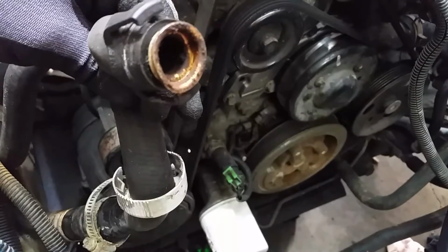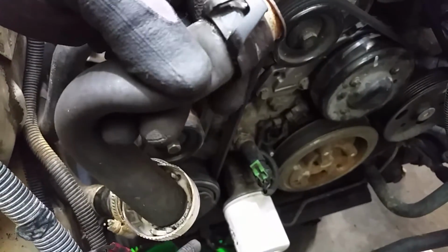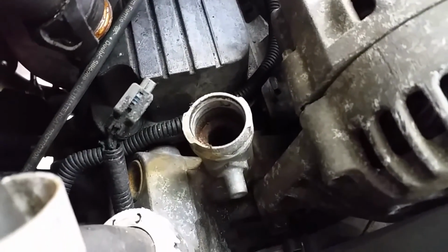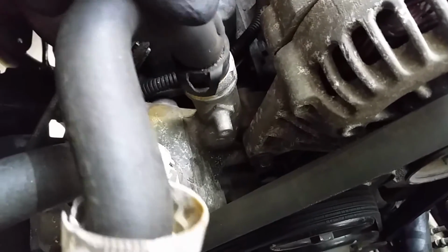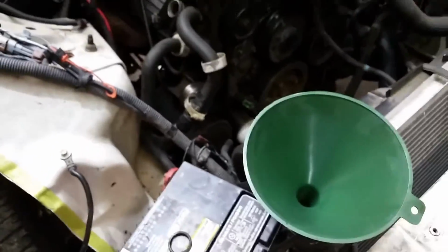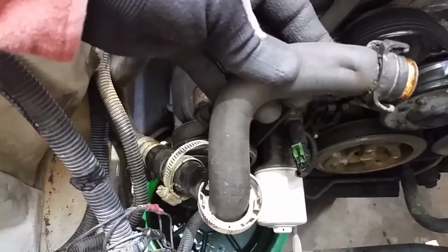So, what do you do about this end? It's got a funky fitting on it. It's got an O-ring that goes on it. And then this attachment here actually has to be press fit on the rubber hose. Well, look at this aluminum housing. There's no threads in it. So there has to be a kit or some way to fix it, or replace the heater hoses altogether, which I think I priced anywhere between $120 and $160 for this car, for factory heater hoses, over one stupid cut, real close to the fitting, and you can't fix it.